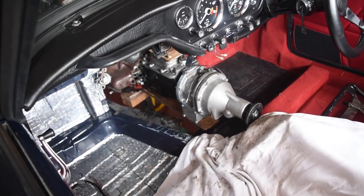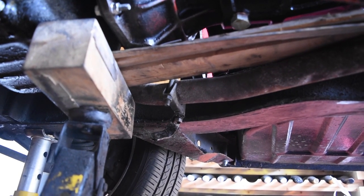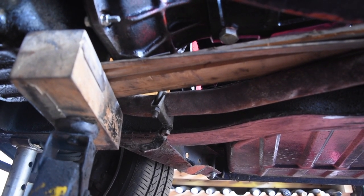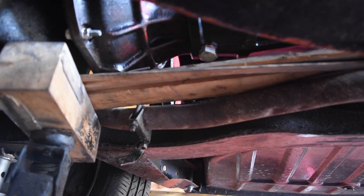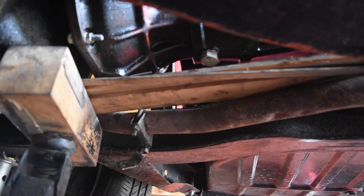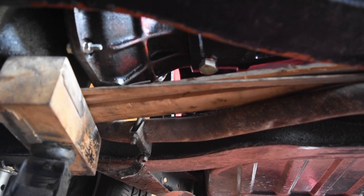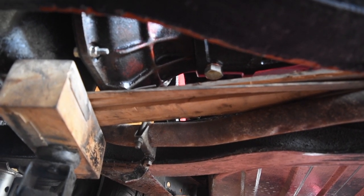Right, so gearbox is back attached to the engine. You can actually just go underneath. Yeah, you can see I've got a plank of wood between the front of the engine, under the block, supported by the block that's also supporting the sump, and that then is resting on the gearbox mounting plate. So that meant I was able to slide the gearbox along that plank in more or less the right position, and not put any weight onto the input shaft.